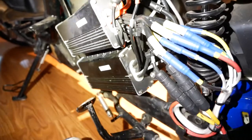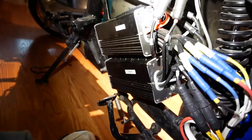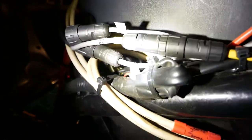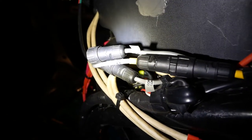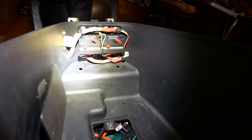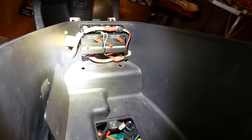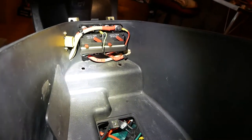What this allows me to do is have full redundancy in the system. If one of these two controllers dies and it's keeping things from working, I can isolate it 100% from everything else — disconnect its CAN bus, and if I find my primary controller is toast and the second one is still working, I can switch those control signals over to that other cable and run exclusively off the secondary controller. Up in here, those breakers work the same way — there is a separate breaker for each controller, so I can electrically isolate an entire controller from the battery pack. There's a completely redundant system in here, and I can run the scooter off of a single controller. In fact, I've done that just to test it out.